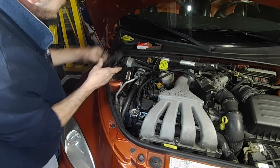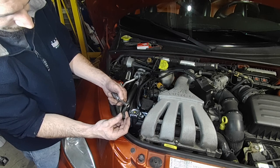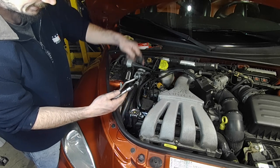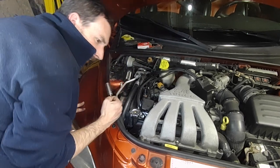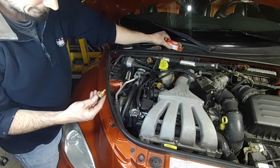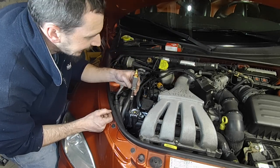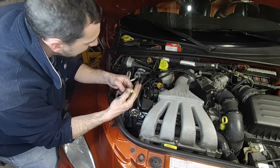I think I'm to the point where I can get it by hand. A little bit of mechanic trickery here - I have a small adapter that adapts to quarter inch, and that adds just the right length to grip it nicely. Also when I put the new sensor in I can tighten it down with that. The thing you heard drop was the sensor - it's out. Before you get too deep into this, just compare your plugs and make sure everything matches. Always compare your new and old parts - it's a dead match.